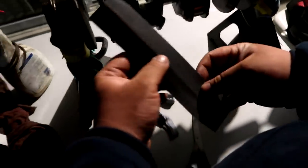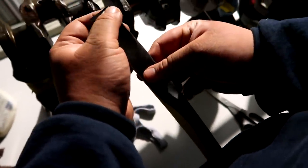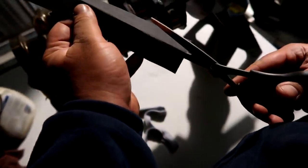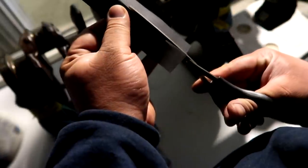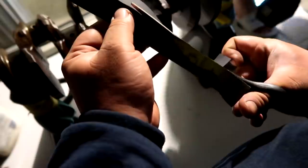I got my little gorilla pod in between my armpits, but pretty much I'm cutting these little strips of 600 grit to about the width of the journal. This one strip right here will probably go through like half, and use the other strip for the other half. We didn't really use too much of the sandpaper, but we did do two cranks, the engine that my cousin built for his brother and the engine that's in my CRX. So cut these strips out right here.